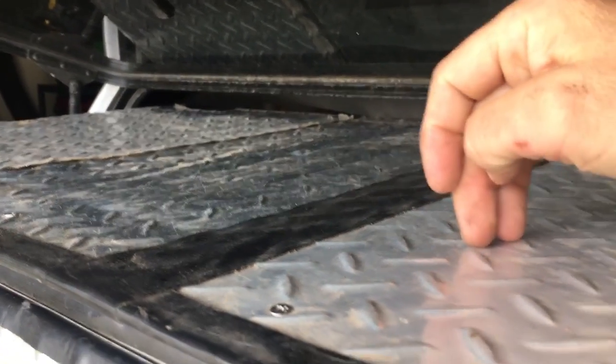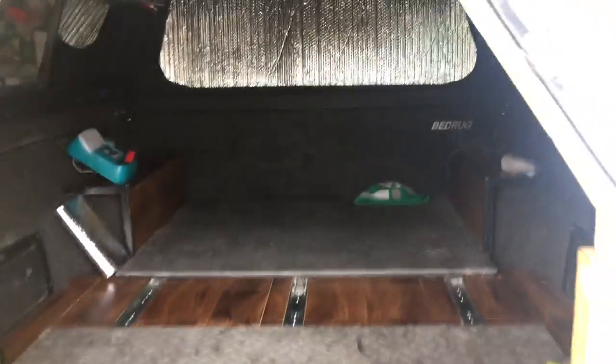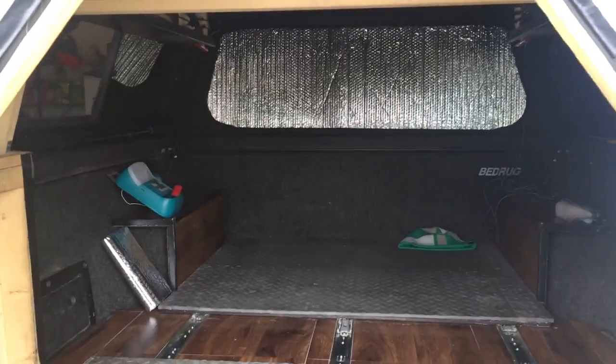With a level surface it just pulls on this area, so you've got to make sure it's a hundred percent waterproof — which mine wasn't. I got a bit lazy toward the end of the build and just put tape over the seams of the aluminized vinyl coating. As a result, this area was actually leaking just a tad. I've since filled it with DAP silicone sealant, but there is some water damage on the inside. I'm going to take off this back panel — one reason I used screws for the paneling is so I can remove it — dry that out and see what's going on behind there, because you certainly don't want mold in such a small space.